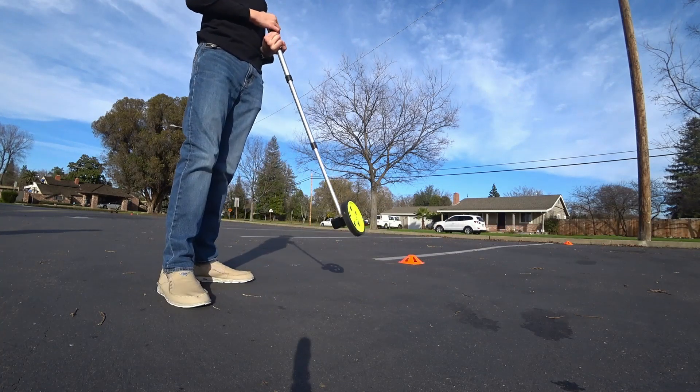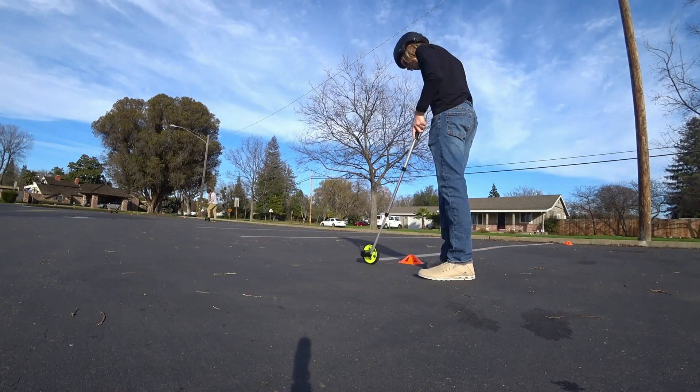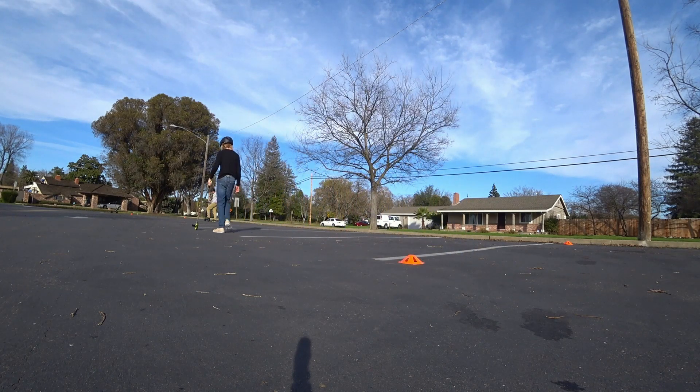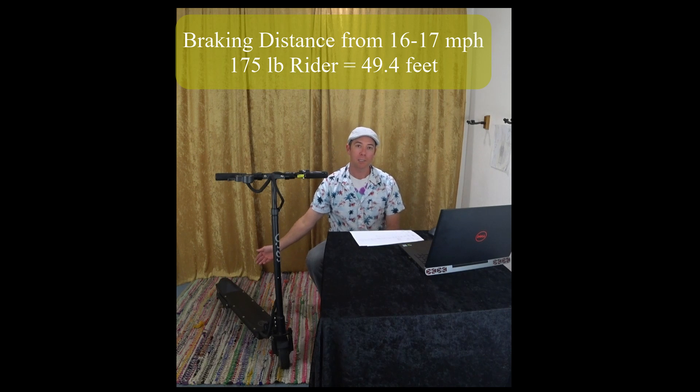As you can see in the braking test footage, it's not great. My average braking distance from 16.5 miles per hour was a little over 49 feet — not awesome. There's a lot of drag with the drum brake on the EcoRico: you can increase braking power, but then you increase drag even more, so I was stuck in the middle ground between drag that might be reducing range and braking performance. With these smaller wheels, cranking up the brake locks it up really fast. I also didn't feel any of the regenerative braking that's supposed to be occurring, which was a bummer.